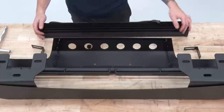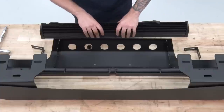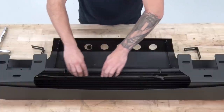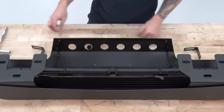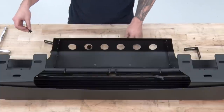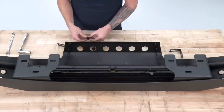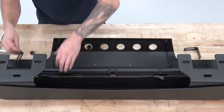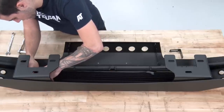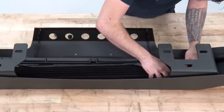Now we can move on to our light bar. To assemble our light bar, it is pretty simple. If you have the grille insert and not the light bar, you can assemble that at this point instead. Slide the light bar right into position and lay it face down. Tuck the wire into the inside of the slots to keep it out of the way for now. The L brackets are gonna hold the light bar to the light bar brackets on the back of the bumper. There are two different size bolts — the smaller ones go straight to the sides where the pre-weld holes are on the light bar, and the longer ones get a nut on the other side going to the bracket. Start with the smaller ones, making sure you have washers attached. Put your light bar bracket into place, slide it through the open slot, and tighten down by hand — leave it a little bit loose for now.